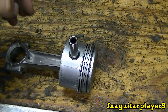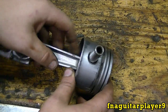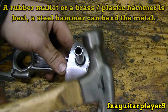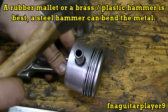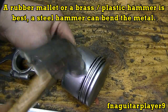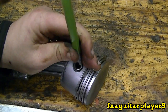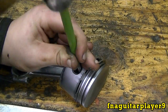To put the rod back in, you just do the same thing but backward — you just pound the wrist pin back in. You also want to soak it in STP or motor oil or something like that so it has some oil in it. A regular hammer probably isn't the best; if you have a small brass hammer, you'll want to use that, and you don't have to hit it very hard at all. Once it gets so far, you can use a punch to pound it the rest of the way — just got to be gentle with it.